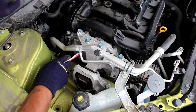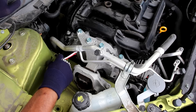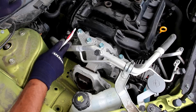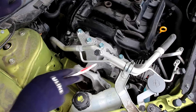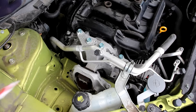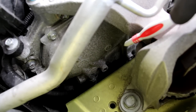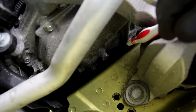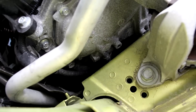On the passenger side of the engine, underneath this cover, is a timing chain — good because you don't have to service it over the life of the vehicle. At the back we have the exhaust camshaft and at the front the intake camshaft, both buried under the bracket for the engine mount. Each of these camshafts has variable valve timing, and they are oil controlled — you can see the oil control valve on the intake side over here and on the exhaust side over there.